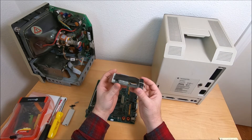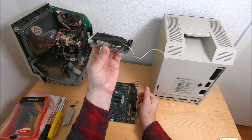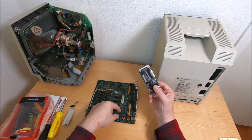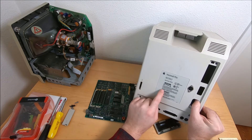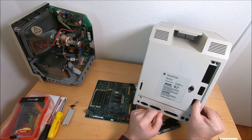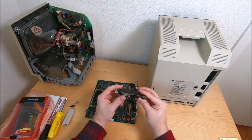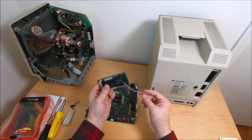It's quite a rare and unique item. I did some research on Google and I didn't find any information, no schematic, and I didn't find another one like it. I know there was a video adapter that does exist for the Macintosh SE and Macintosh SE30, which uses a long connector that you plug in. On the SE and SE30 there's an expansion slot door — you remove the door, mount it to a bracket plate with a 9-pin connector, and then you plug it into an RGB monitor. This one has an 8-pin connector, which for me is something new and interesting. I'd really like to figure out the pinout and try to plug it in and see how well it performs on a bigger monitor.